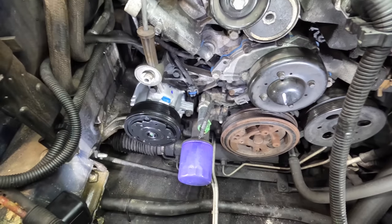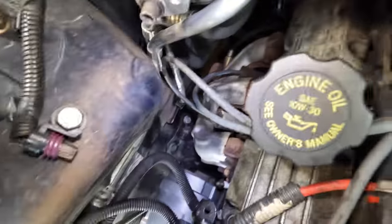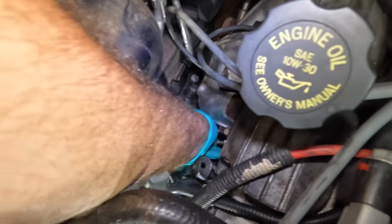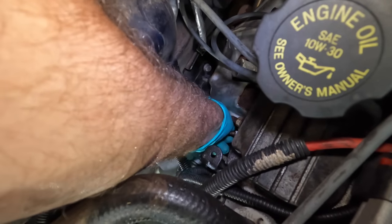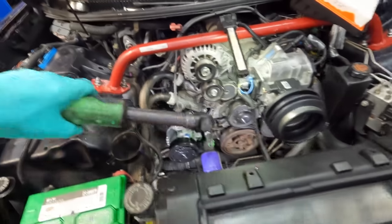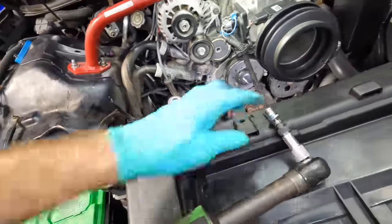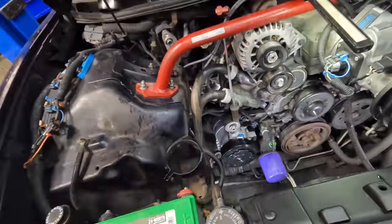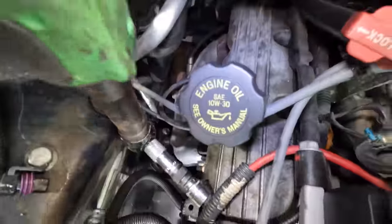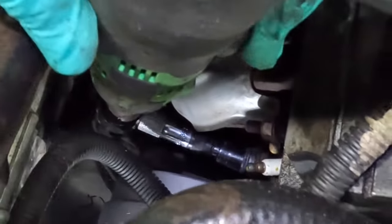Okay. Now, we need to grab this one here. That's that 15 bracket bolt that goes way down in the back, kind of behind the manifold. There we go. I know you guys can't really see in there. It's in the depths. Okay, got it threaded. That one has started. So now, switch this out with a 15 and get that back one tight, and then we'll torque these front ones. Socket switch. Coming in. Let's get way down in there. See it in there? That's way down there.